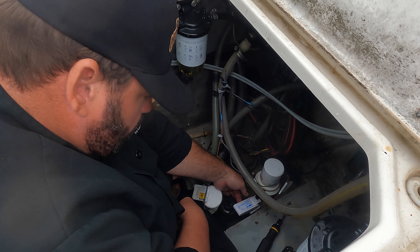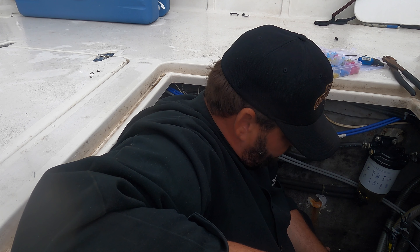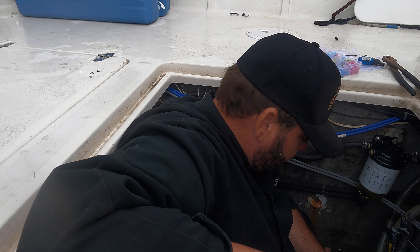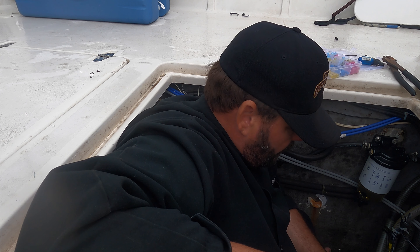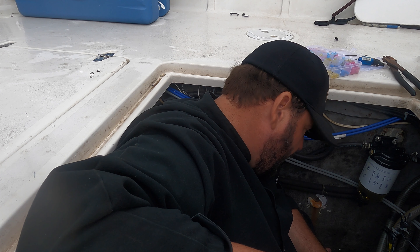Bilge pump's working great — we're ready to roll. That's the end of our bilge maintenance project for today — a simple, very successful project. Make sure your connections are good, wires are good, and cut back to good wire with solid amperage. Make sure your float switch is clear of debris, your bilge pump is clear of debris, and clean your bilge so nothing obstructs the pump or the float switch. Thanks for joining today — make sure you like, subscribe, share, and leave a comment below.